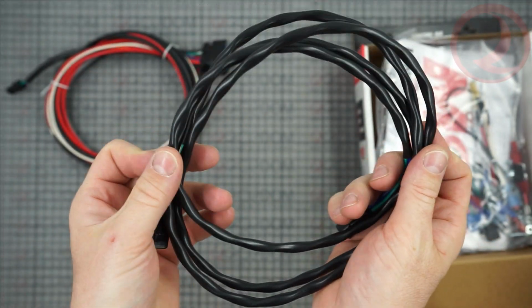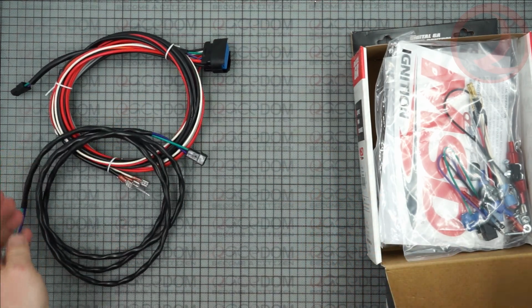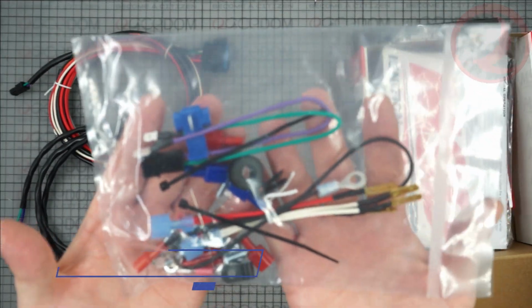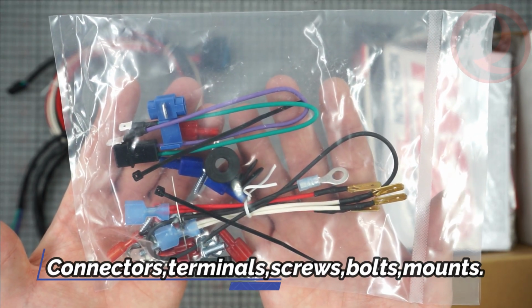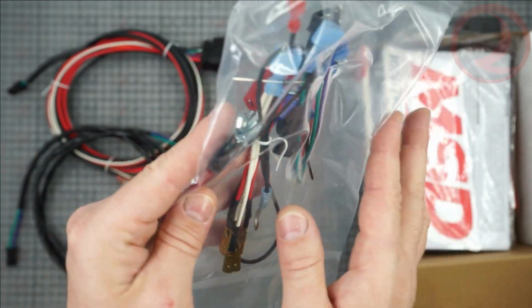The digital 6A is a microprocessor-controlled, capacitive discharge ignition that multi-sparks up to 3000 RPM, providing easy starts, a clean, smooth idle and quick throttle response by optimizing your engine's efficiency. Above 3000 RPM, a single spark stays lit for up to 20 degrees of crankshaft rotation, ensuring a complete burn of the air-fuel mixture in every cylinder.